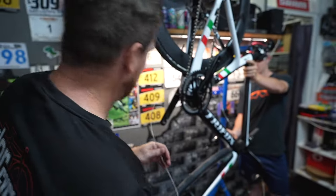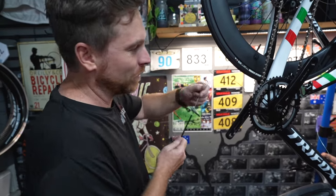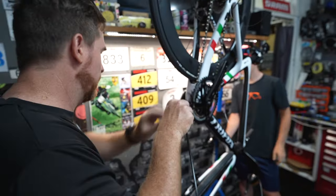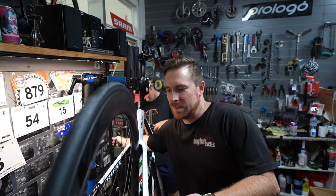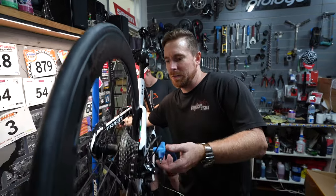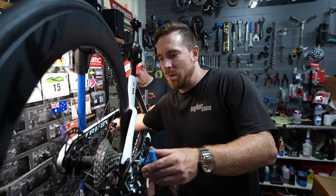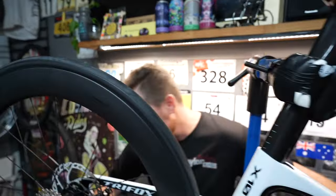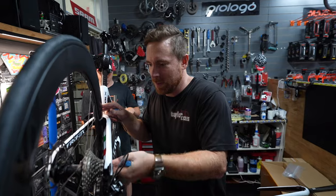So you're actually making the hole bigger in the frame — with a rubber mallet, my best friend in this build. Look at that — it goes in now! We have brakes. These are single-piston brakes, so my trick to center them is to do up one side quite tight. If the cable hardly moves, then squeeze the rear brake — it'll rub a bit. If the brakes are too tight then you back this off.